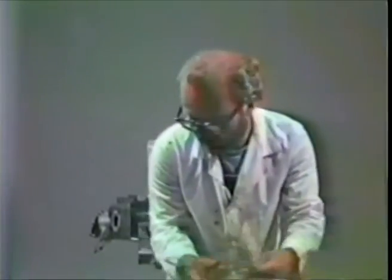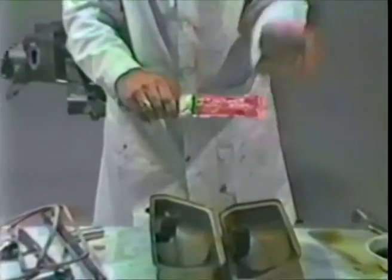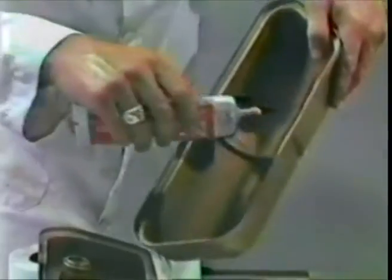And for the valve cover, the best thing to use that I have found through multitudinous experience is the 3M Super Weather Stripping Adhesive. It's also known lovingly in the trade as Gorilla Snot because it has the look and consistency of what Gorilla Snot might actually look like. Okay? Take and wipe off the initial stuff that comes out of the tube, and then lay a bead, blows bubbles too, about 1/8 of an inch wide, all the way around.